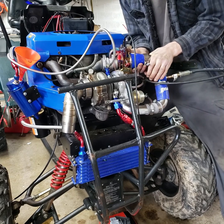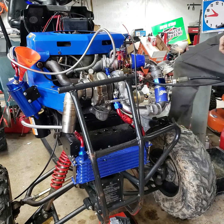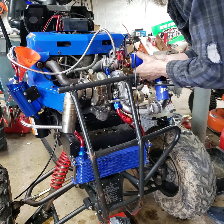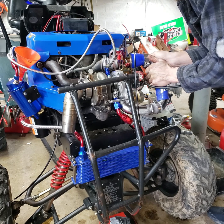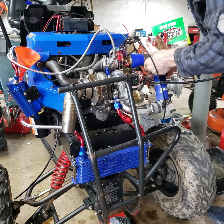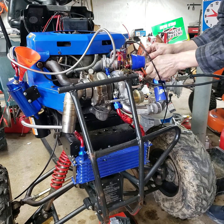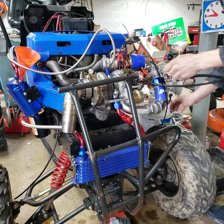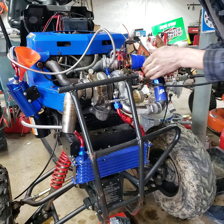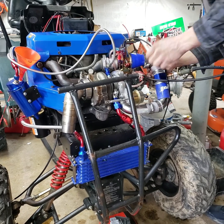Stay tuned for that. I've got a Craftsman that's already built and running with a Peerless 700 and a 12-and-a-half, 28 CID Briggs on it — I've got two inches off the ground. I'm going to try to put the snowmobile engine on it. I have that 440cc Jag; I ran it yesterday and it's running great. That Craftsman is a nice machine; I just have to decide how I want to complete it.